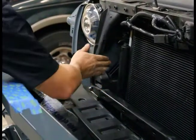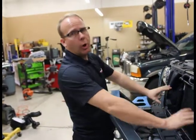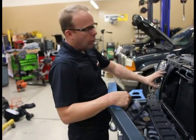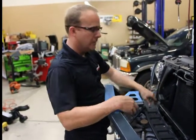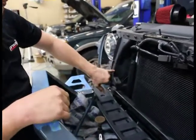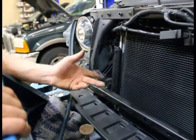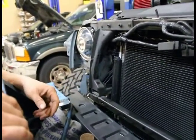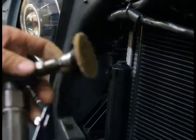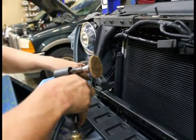I'll do that video live so you can see all of what it takes, how much you've got to do and how it should look when you're done. So the front mount intercooler — ours is the largest on the market for the maximum amount of heat exchange to make the maximum amount of power. We use large intercooler tubing, large intercooler hoses, and we need to clearance these sections on both sides, the passenger and the driver side. You can see where the factory push pins were for the air deflectors — they're good guides and you'll see we're going to trim this area here. I'm going to show you the tool I use, which is an air tool with a cookie-type sanding wheel on it.